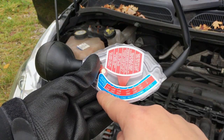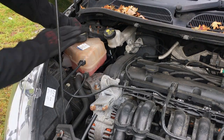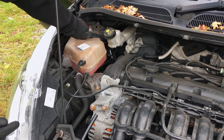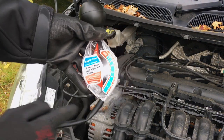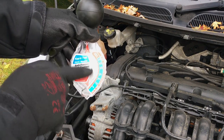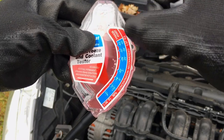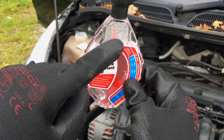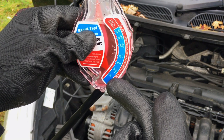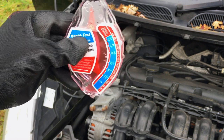On the front it shows you what temperature this will protect down to in cold weather, and on the back it shows how high a temperature it will protect to. In the UK, the cold temperature is what we want to focus on. To use it, just simply take the cap off — if the car's warm, watch out because this can be quite hot and you don't want the pressurized container to get on your hands. Very simply, all we do is stick it in the anti-freeze, push this to make it fill to the level line, and it gives us a reading. Give a gentle flick to move any bubbles, make sure the indicator is level and vertical. As you can see, our coolant is almost off the scale — it's only protecting down to about minus 12 degrees. So that definitely needs some coolant added, otherwise the car's going to freeze in the winter. Good job we tested that.